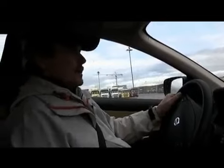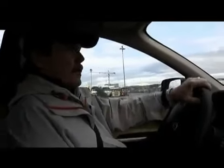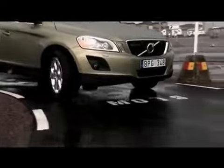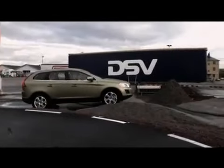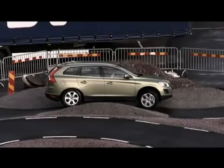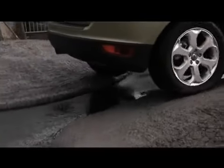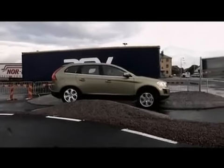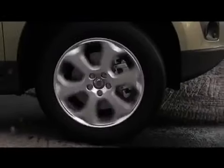So, on the top of the hill, I take my feet away from the pedals and we'll see what happens. We go over some bumps and here we can see that we have the right front wheel and the left rear wheel spinning. That means the central differential, the Haldex, is doing its work, putting the power back to the wheel, but we can't drive away.